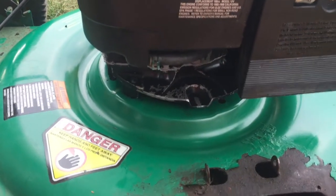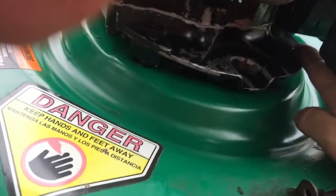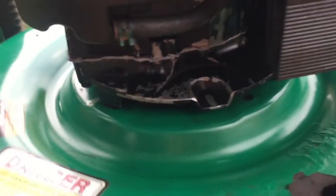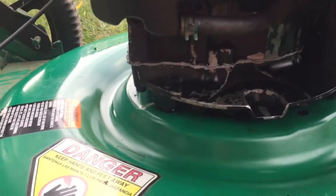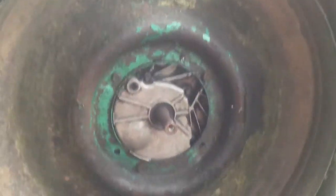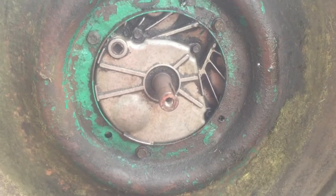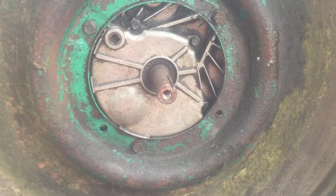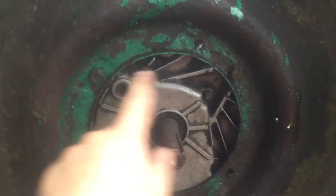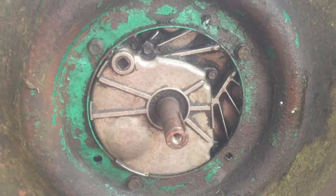All right, so the gasket has set up for about an hour or two. So now the next step is to flip over the engine, put it back on the deck, and then those 3 bolts underneath. One goes in there, there, over there, and then one on the other side. Hard to show on camera because I'll have to lift up the deck and screw those on. All right, so this is the underside of the deck, and I just put on these 3 bolts right here that connect the engine to the deck. Again, 13 millimeter, and I found it easy just to flip it on its side and work through the ejection point to start the bolts, tighten them up as much as I could by hand, and then use the ratchet when it was turned sideways to get it snug.